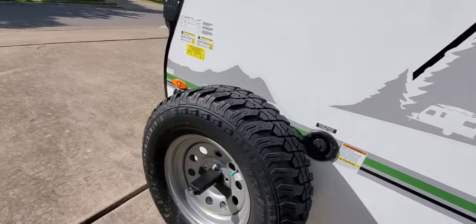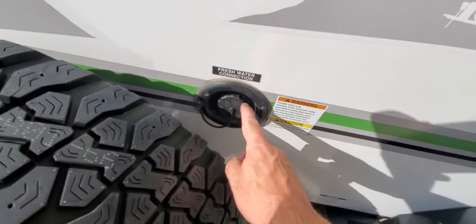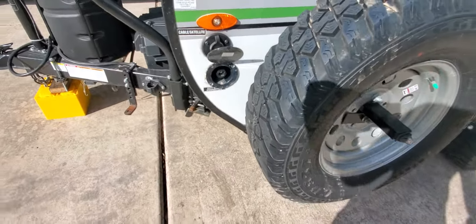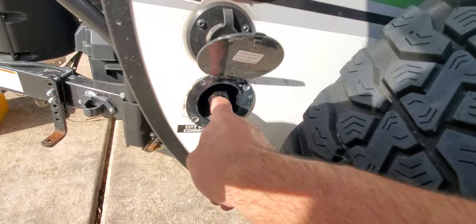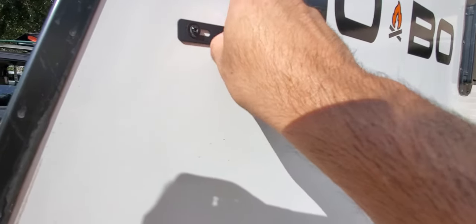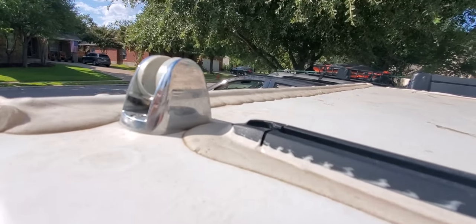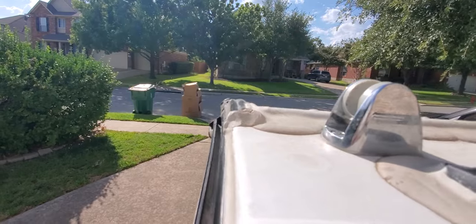Another custom upgrade: from the factory you have a fresh water connection and a city water connection. We changed the setup so you can use the fresh water connection for city water or to fill the fresh tanks, while the city water connection now has a quick-release latch so you can put the shower on this side. We also added a connector for a portable propane water heater and a small shower holder out here so you can have an extensible outdoor shower.